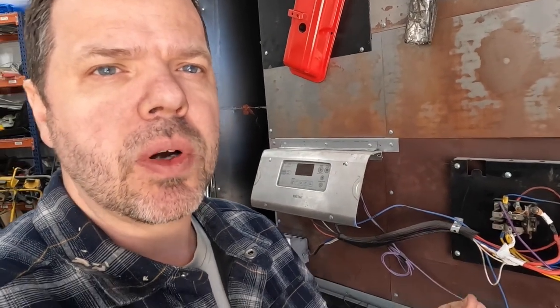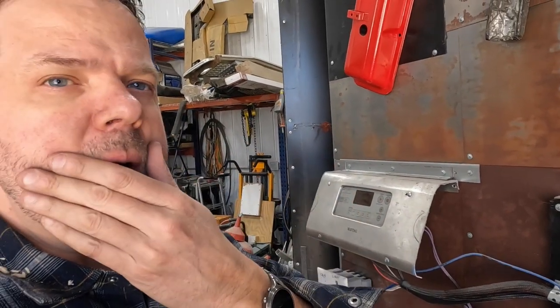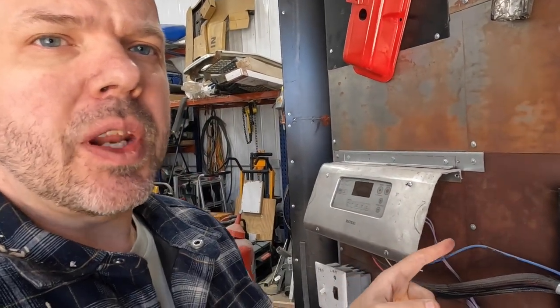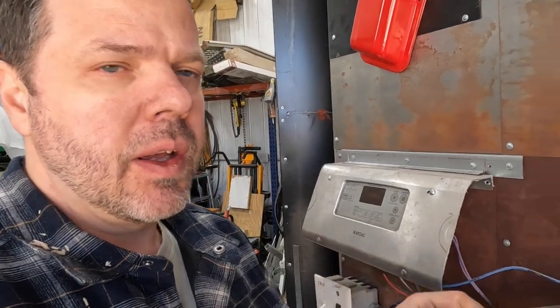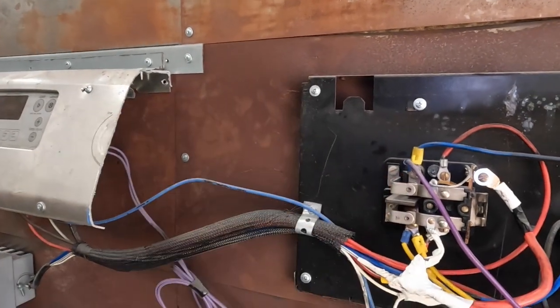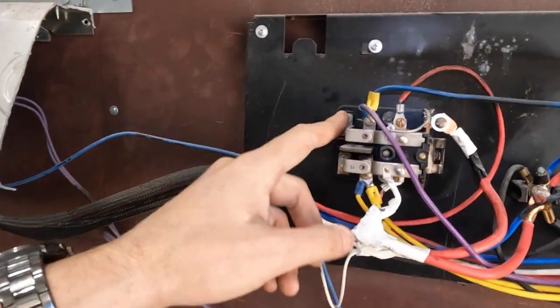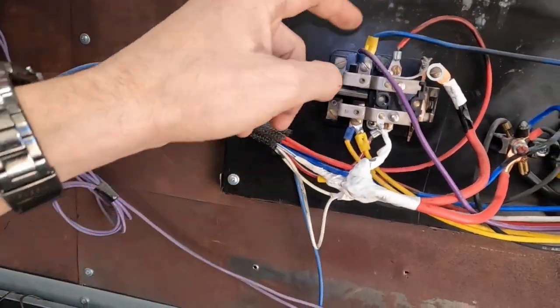It's time for everybody's most fun part, wiring. Okay, this is how this thing was wired. Your mileage may vary based on your oven, but this is how this one worked. Originally we wanted 2 elements, but we upgraded to 4. The issue we ran into was that the original control panel would not handle the amperage. So we took the load from here and moved it to a relay over here. This relay will handle, I think, 25 amps in our case, but it's broken up into 2 sides. So 2 elements here, 2 elements here.